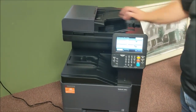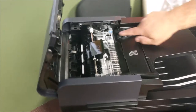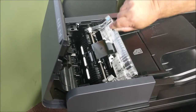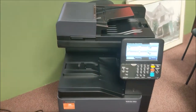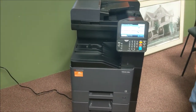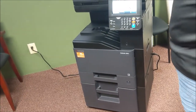If the jam is located up here in the doc feeder, it opens up like this. There is a blue sticker labeled F on this one — it opens up and you can remove the jam. That basically is your unjamming area. The only difference is if you had more trays below, there would be an additional door down where the stand is that you would open up.